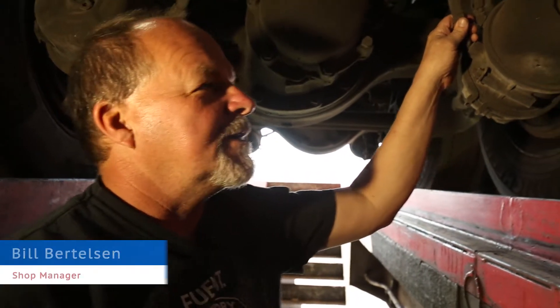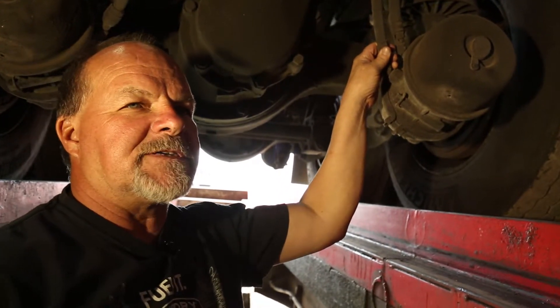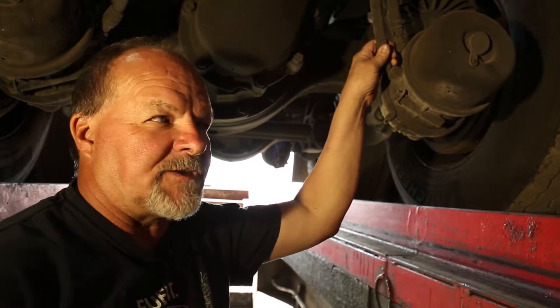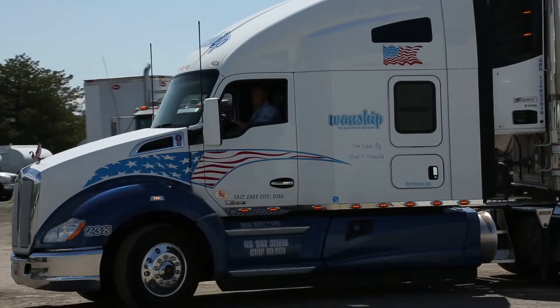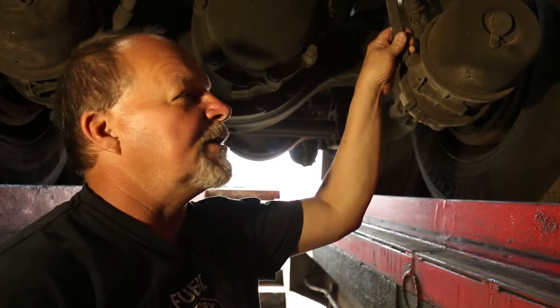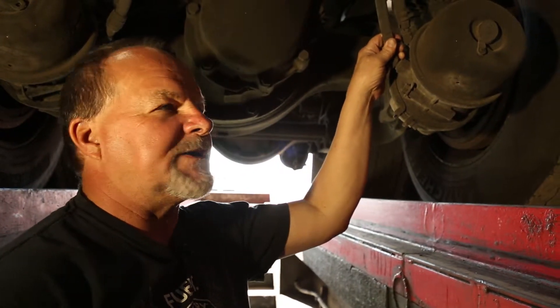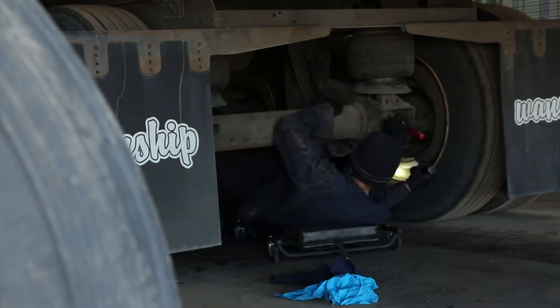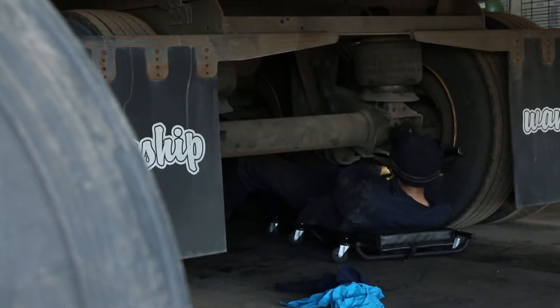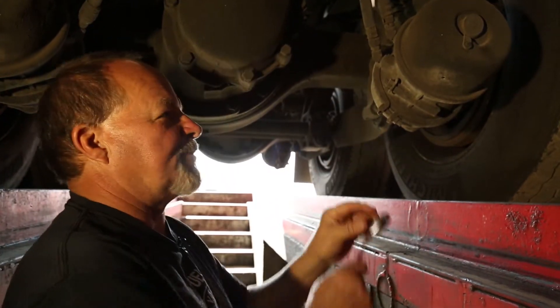This is on caging a brake. The reason you would cage a brake is if you have a problem in the emergency system — your emergency brake. If you have a leak on your emergency side, you can cage the brake. Caging the brake only releases the emergency brake on that tire; it does not fix the air leak, which you would have to address separately.